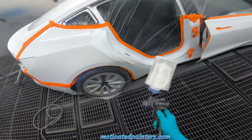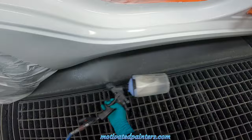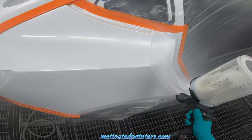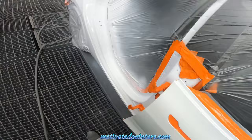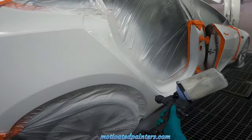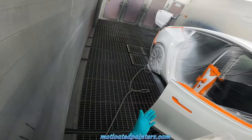Same thing over here — just move, move, move right, move fast, don't linger. And because of that blender it's going to help to blend it out. We're going to spray this way so we don't want to put base in here. Beautiful — and then here we're just going to open it up. 27 psi, we're not going to do 16 because we don't need coverage here.